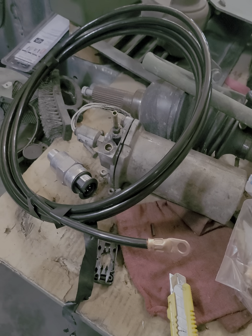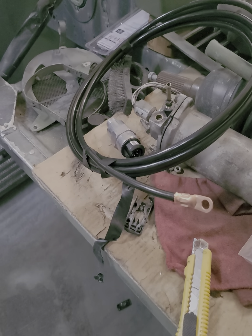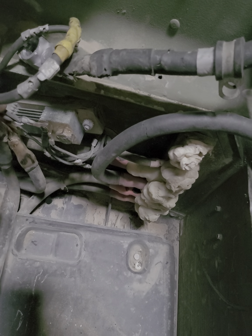I'm making the ground wire right now. I'm gonna run this end from the negative ground up to the block, and then from there run it to the dash ground for all the lights and gauges. From there I'm gonna run a small one from the back of the dash where all the gauge grounds are to the box. Then I'll make a smaller one, maybe six to eight inches, for the alternator. That's really all you need — very clean.